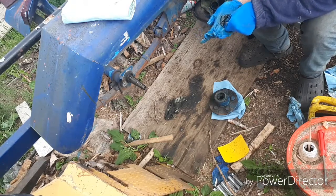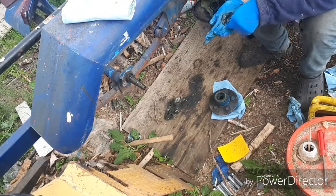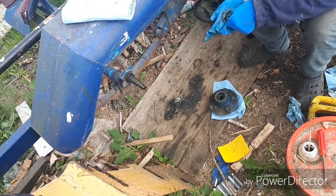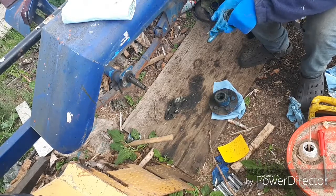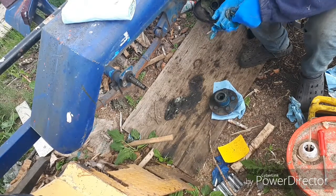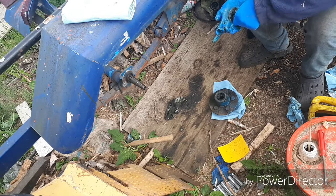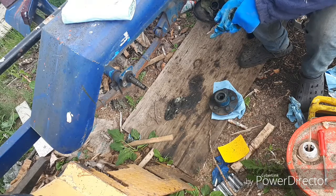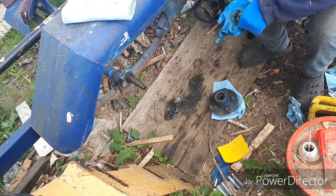For a 3,500 pound axle, one of those tubes should do 2 wheels. It's $12 a tube, so this trailer will take $24 worth of grease by the time it's all greased up. That's $12 Canadian. Just smearing grease around the outside of the bearing and throwing it in there is not good enough. You gotta squeeze it through the rollers on the back side through the outside.